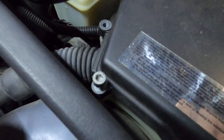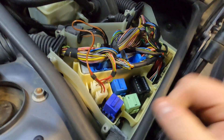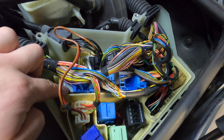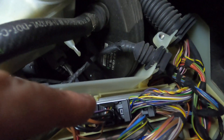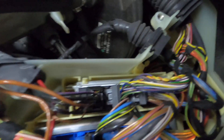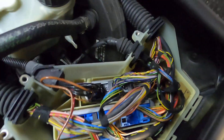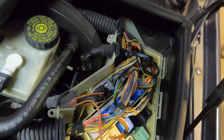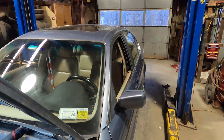Once we remove all four - although one of mine is pretty much locked in there but it's free - we're going to remove the cover by lifting it up and getting it out of the way. Now this first thing, from what I know, if you have an automatic BMW E46 this works with your transmission cooler - only the automatic ones have this. We're going to be disregarding it. But that right there is our DME, the one that comes stock with the car. What we're going to have to do is unclip all of these clips and remove that one by pushing the white pins up and taking them out, then put the new one with the EWS delete in. I'm going to wear gloves because it's electronics and I come from a computer background. And before we get started I'm going to disconnect the negative terminal from the battery in the trunk so it's safe to work on.